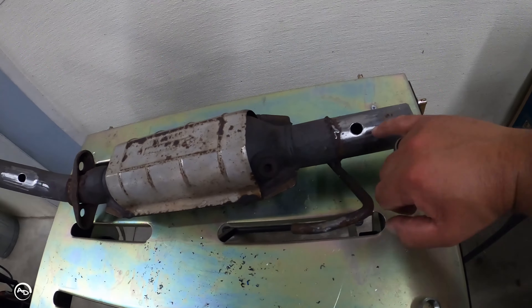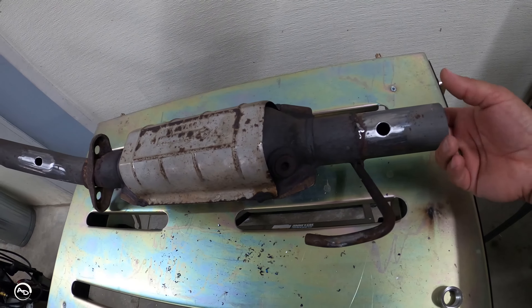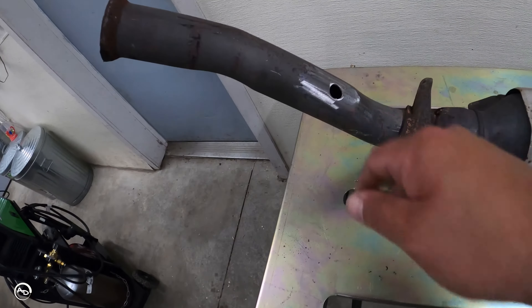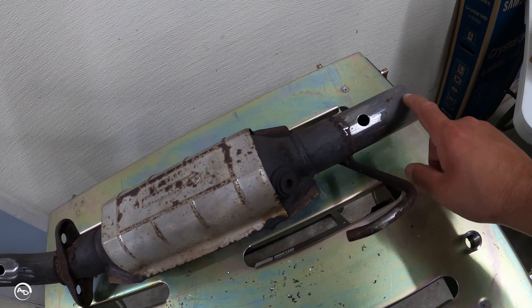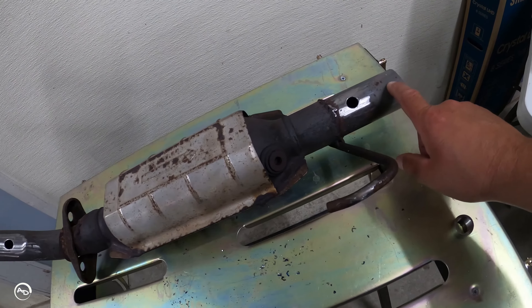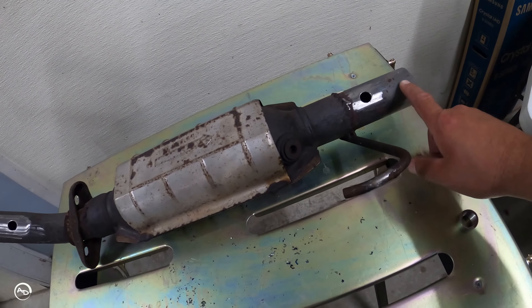Step drilling is done. I used a little round file just to clean up the inside a bit, then took the flat disc and got it all cleaned up for the weld. Ready to weld these bad boys in. I just want to quickly check if we've got clamps for these, otherwise I'll figure out what to do, but the next clip should be welding the bungs on.